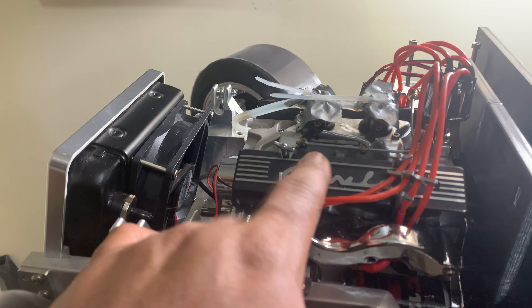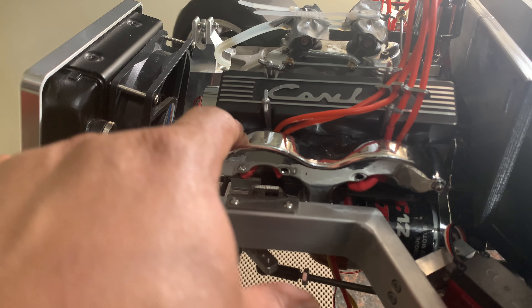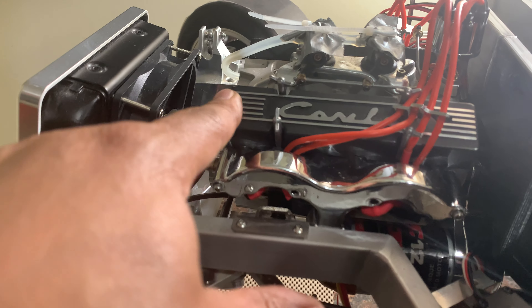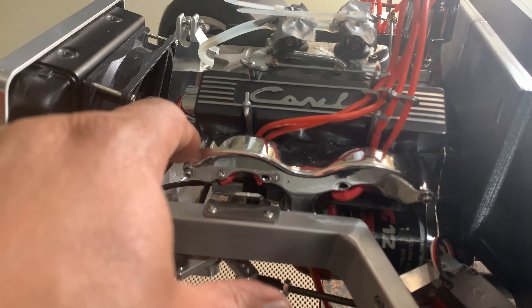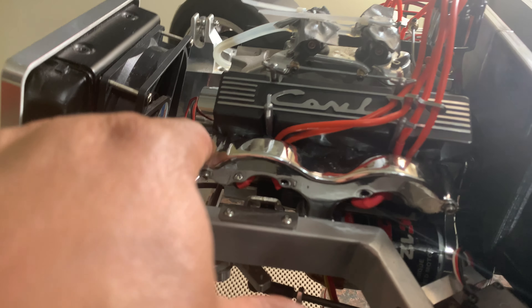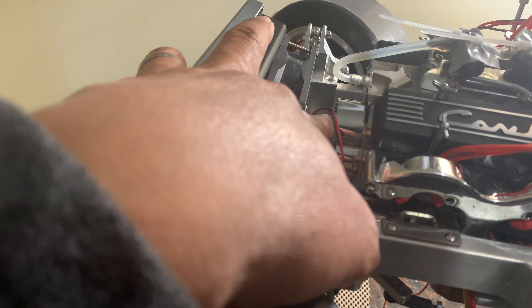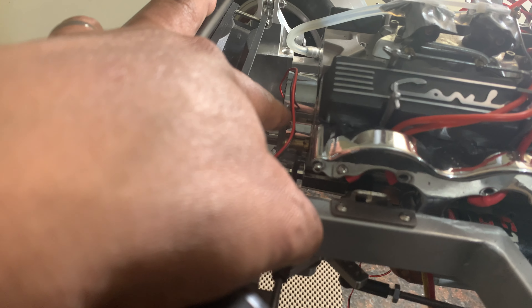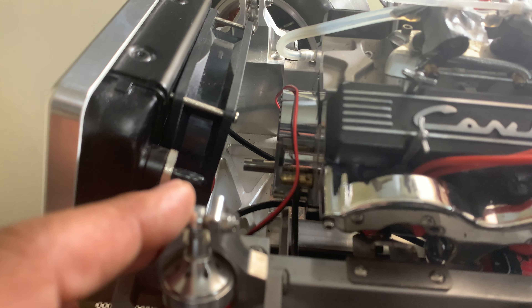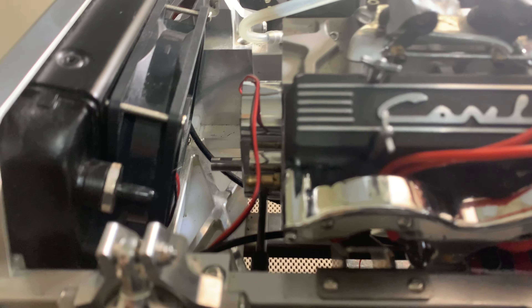This car's body and floor belong to this one. Before I put it back on I'm going to change out the valve covers — he would like to have Corvette valve covers on this one. I'm going to take off the headers and put a plate there. These engines are the Australian Gary Olmers V8s — nice engines. Gary uses cork between the header and block, but I'm putting back a metal flange between the two, like Conley had it, to make it look more stock and more scale. I'm also taking off the external water pump and putting on an original Conley internal water pump.